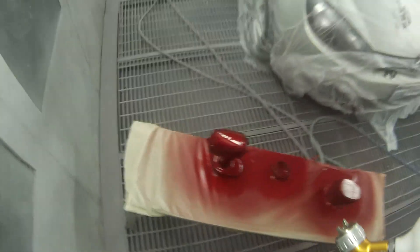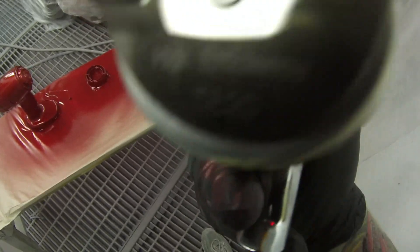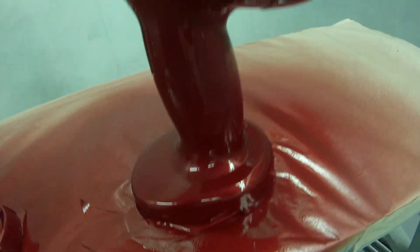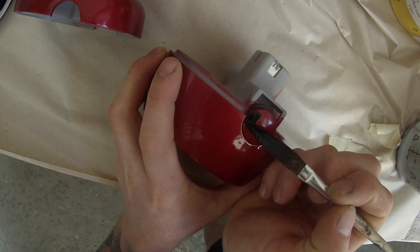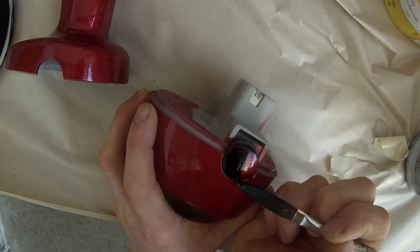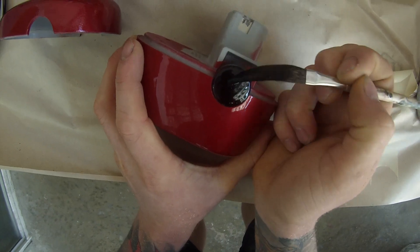There's a little bit of a finishing touch I decided to do to make it look real nice. That's the gun I used — the Pro Lite with the TE20 on it, awesome gun, my everyday gun with clear coat. There were a couple of little stickers that go on the very front — a sticker with a hand on it indicating not to grab the globe because it's warm. I decided to put them back on. So this is just a bit of 2K black — I didn't even sand that, just touching it straight up, 2K black straight out of the can with a bit of hardener and a bit of accelerator. Touch up brush straight over and it looks real nice — you're left with a gloss finish, and it breaks it up a bit too.